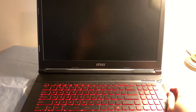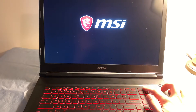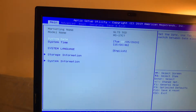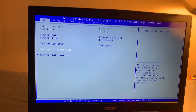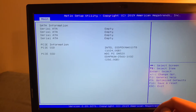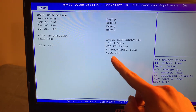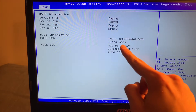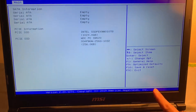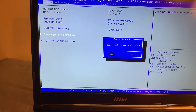Get this ready to boot. Hit the power key, and while this is loading go ahead and hit the delete key a few times — that's the MSI trigger for the BIOS setup. On the main screen there's an option that says storage information; use the down arrow key to get to that. You're going to want to make sure it reads your SSD. Now we're seeing the Western Digital 256 gigabyte that I had, and also the Intel one terabyte. Go ahead and hit Escape, then exit, quit without saving — yes on that.